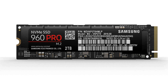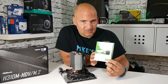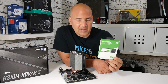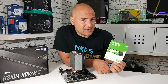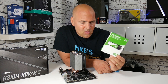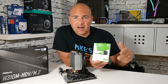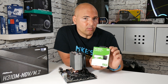The NVMe ones are higher level and cost considerably more, whereas the SATA SSD type M.2 drives are considerably cheaper. This one is a Western Digital Green, 240GB, currently retailing around £40 in the UK — very good price and performance. Another benefit is that they're easy to install and fit directly on the motherboard, so you don't have to worry about supplementary power or data cables, making for a very clean build.